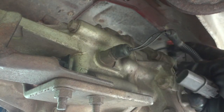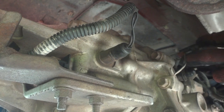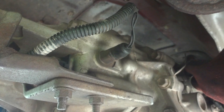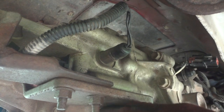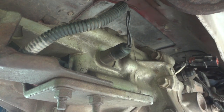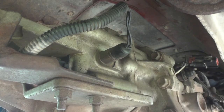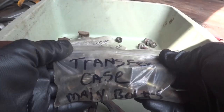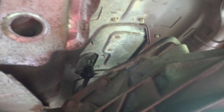There are a couple of plugs and a wiring harness to deal with. Unplug this one here, push it out, and there's another plug you've got to unplug. There's also a wiring harness to unplug — these are a little fickle to get apart but they will come apart. There may be a vacuum line on top. Other than that, we're ready to put the transmission jack under here and separate this. The back of the transmission is sealed and I'm not worried about leakage. Label everything — I have all my transfer case bolts labeled.